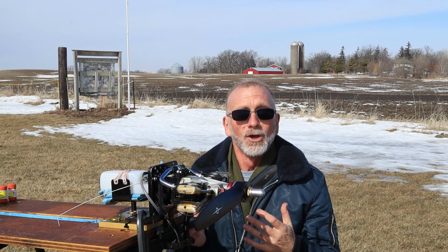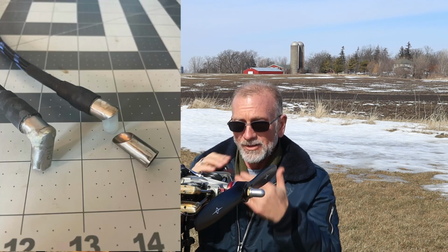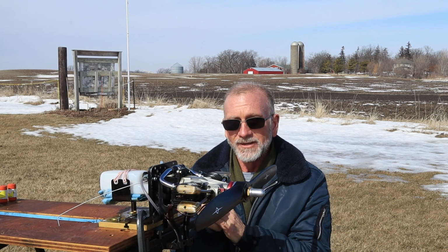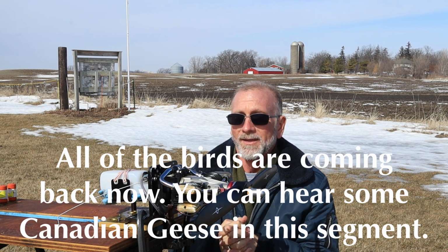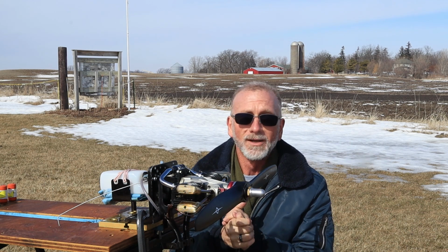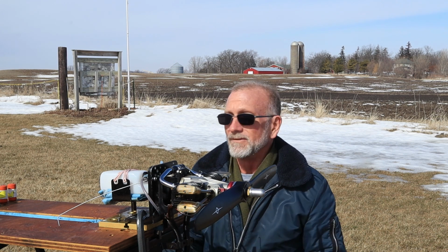I was gonna run it as glow ignition, but when I was going to put the CH ignition harnesses on the 90 degree, one of the 90 degree couplers broke. And I don't know, they don't look like they're spot welded or welded very good or what, but I was not able to solder the thing back together. I tried JB welding it, that didn't work. So as it stands right now, one of the CH ignition harnesses won't lock on to a plug like it's supposed to. And I really don't think I can even attempt to run it like that, because if it's not going to be locked on and making full contact, I will have issues.